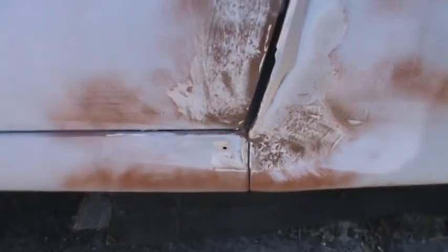Well, I put a little guide coat on this, and you can see right in this area here is where it's starting to sand into the primer. With all that whole area right there that's still kind of red, that all needs Bondo. So I'll just mix me a batch up. Try to put a skin in there, let that harden, move on to the next.